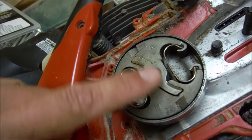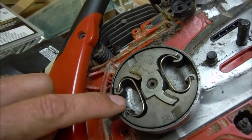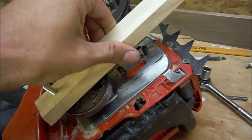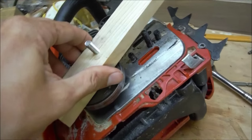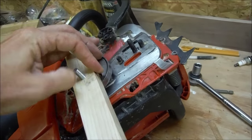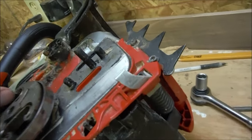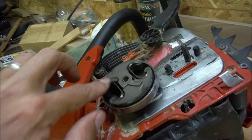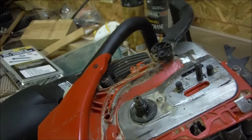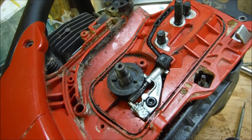This piece and this piece on the clutch are quite heavy, so I doubt I could damage them. That's what I did, and by gosh it worked — saved me money, a trip to the store, and a bunch of time. The only thing is you do have to turn it pretty hard, and there doesn't seem to be any good way to secure a chainsaw on a bench because the spring mounts make the motor not rigid. You just have to hold it against your body and give it a good turn. I got the clutch off — maybe this will help some of you.